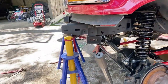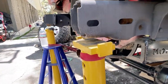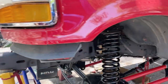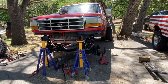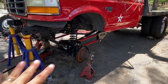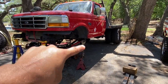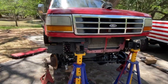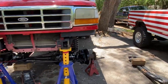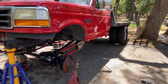It is now officially under its own weight with the springs installed — nothing else supporting it, completely on springs. I'm going to throw the tires on even without the front sway bar or shocks and just roll it forward. Measuring here I got 33 inches on one side and 29 and three-quarters on the other — I think the rear tires are causing this side to sit higher and pushing up the entire body, so we'll roll it forward onto flat ground and get proper measurements.